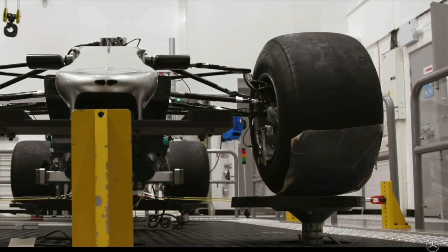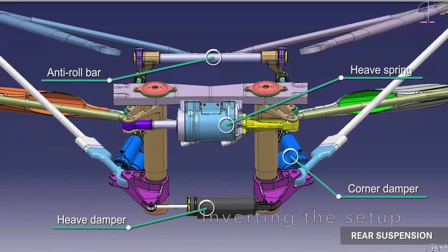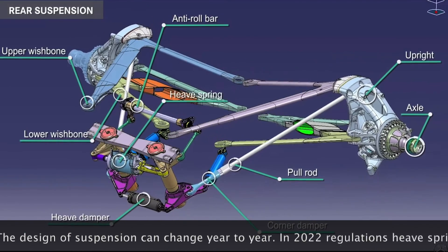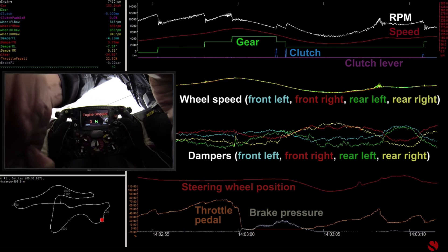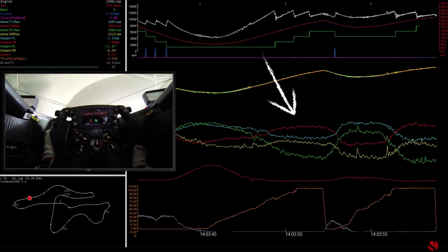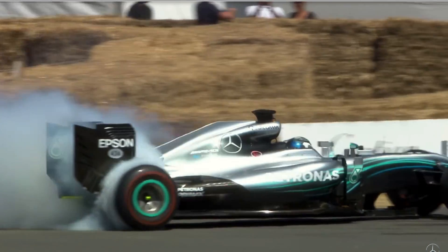Those elements connect to the outboard suspension, which is hidden away behind the wheels. Inboard suspension is composed of anti-roll bar, heave spring, corner damper, and heave damper — so all the dampers are hidden in a package inside the body of the car. Internal suspension and dampers have sensors that measure the loads coming from the suspension. The maximum load the suspension system is designed to endure is calculated from previous years' collected data as well as simulations.